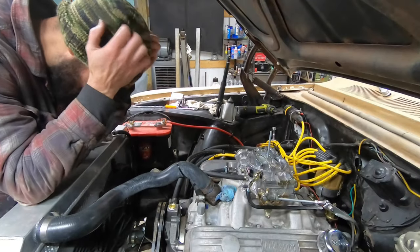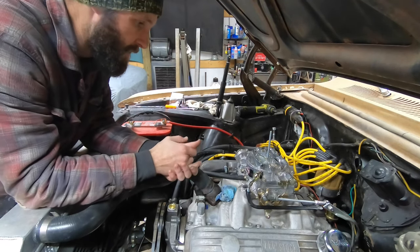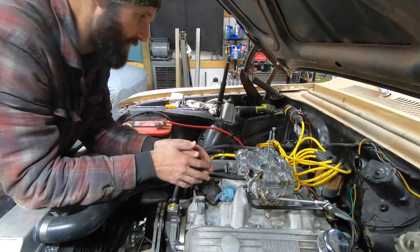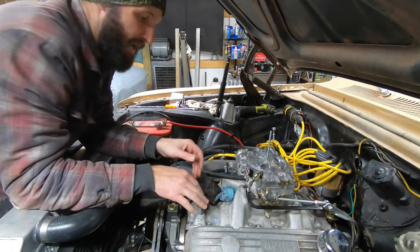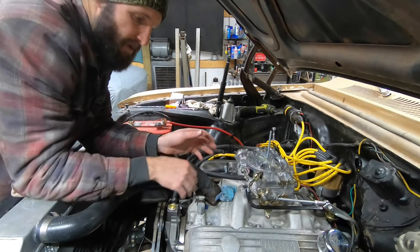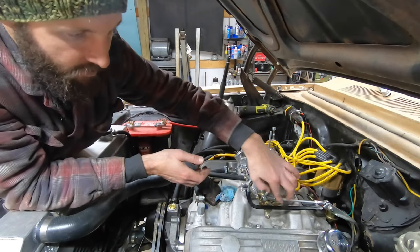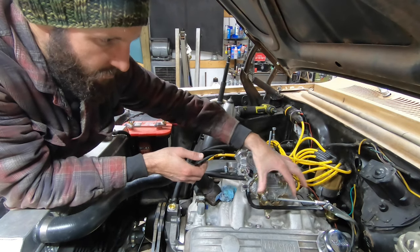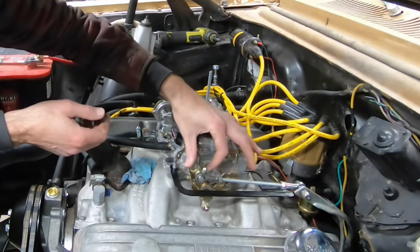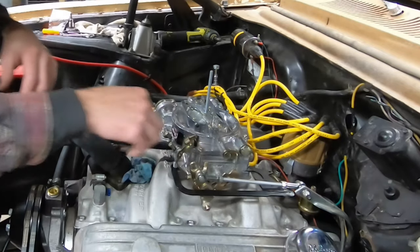Well, at some point the camera turned off, and I don't know when or where that was. So I'll just tell you where we're at. And who knows what got cut off and what didn't until I actually do some of the editing. But the bracket's in, the carburetor's bolted down. We've got no carb spacer under it, so we're as low as we can go on this intake manifold. I've got the linkage in for the throttle pedal, and we can't quite get to idle.